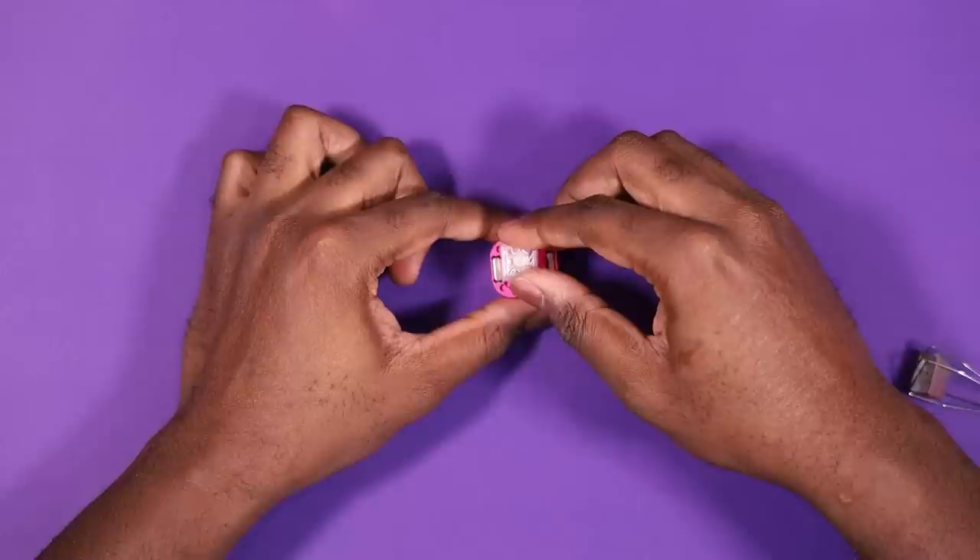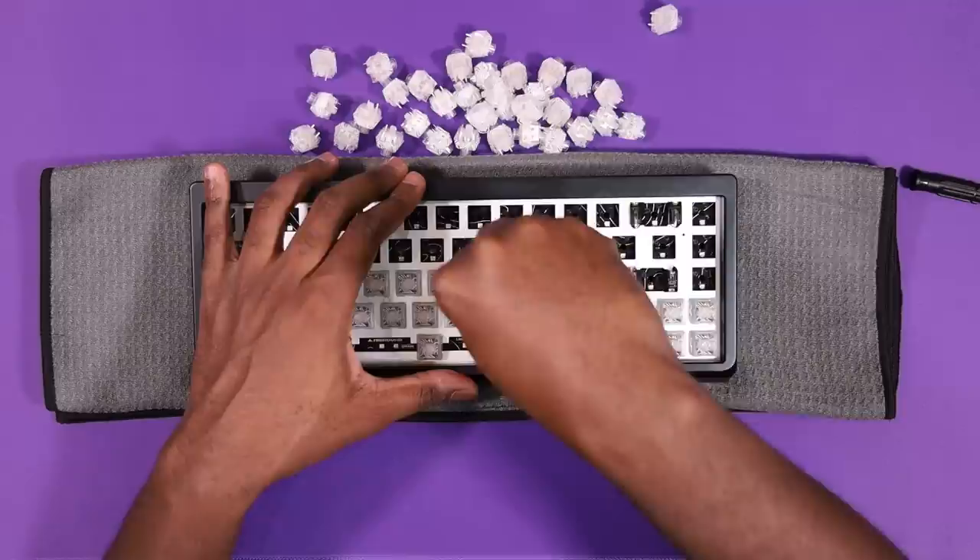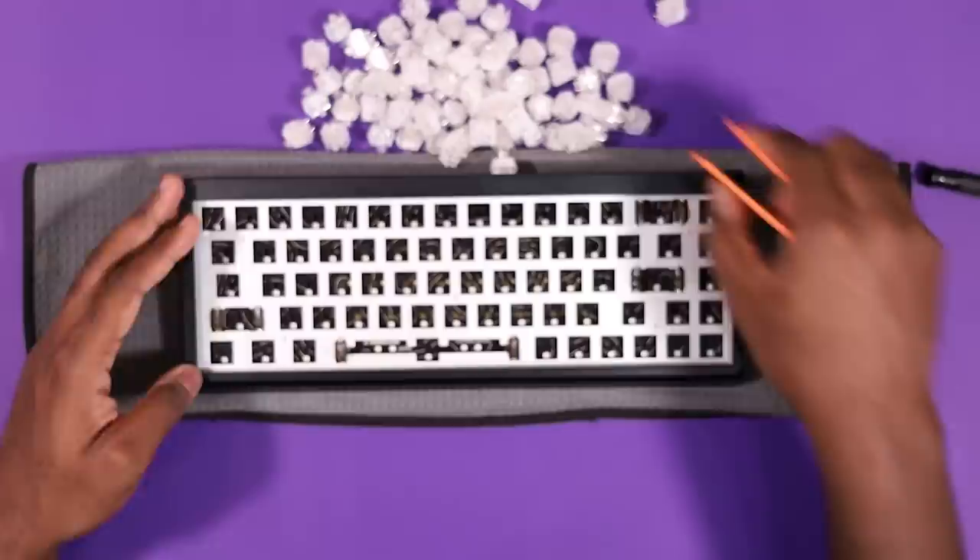The Geo switches are linear and pre-lubed. The springs have a good coating of lube and are virtually silent, but there's about one drop of lube visible only on the world's most powerful microscope on the switch housing rails — it's dry. There's a varying and inconsistent amount of lube on the stem legs and copper leaves, meaning that if you type fast enough, half the switches feel dry and the other half have a really sluggish, high-drag feeling. Combined with a not-very-solid push feel, a lighter bottom-out spring weight, slightly shorter key travel, and a really dull bottoming-out sound, these switches are not great. Fortunately the PCB has hot-swap sockets so you can get rid of them.